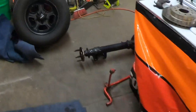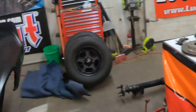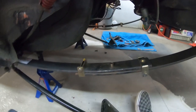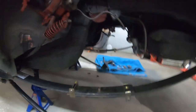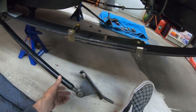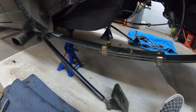The rear end is out — we're basically at two hours. I'm going to clean stuff up and then start putting things back together. Sugar is my drug of choice and that Mexican Coke gave me extra energy, so I'm going to take a little time and clean up underneath the car. I also want to take the cal tracks apart, clean them up, maybe paint them a bit, re-anti-seize all the joints, and put them back together.